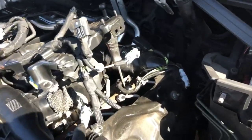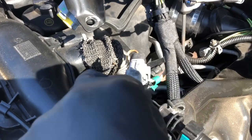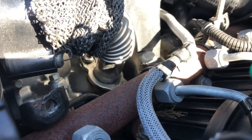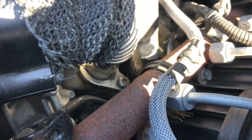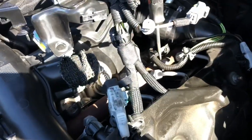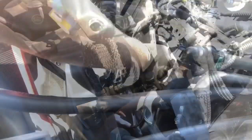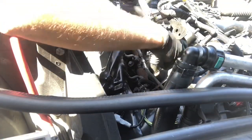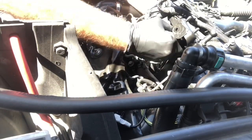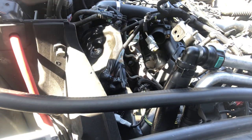Over on this side, I've used a screwdriver to prop up the support bracket. It's a very messy-looking engine, the TDV8, but if I pull some bits back you can see a torx bolt there and there on the end - you can actually get straight onto those, it's just awkward to film. That's one end, and the other end is right here, so easy enough to get to. We can do one side, get the blanking plates on, and I'll try to film it on a tripod.